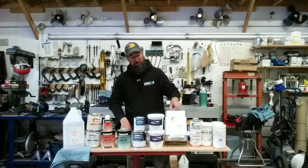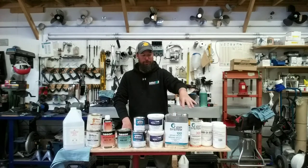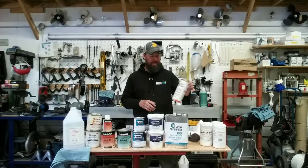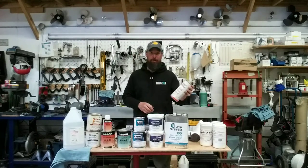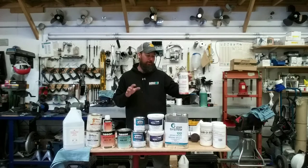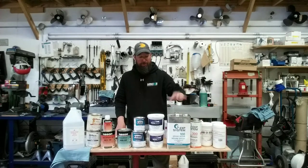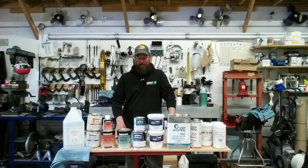We used the EXP System epoxy — a two-part mix requiring a hardener. You can go with fast, slow, or medium hardener; I used intermediate, which gives 18–20 minutes of working time. Mix in small batches. Don't mix one big batch and have it kick on you. After that we laid up the 8-ounce fiberglass mat and used the epoxy resin to attach it to the hull.